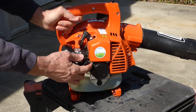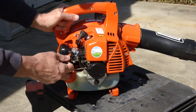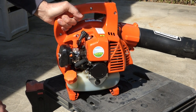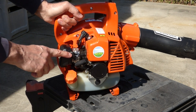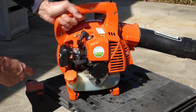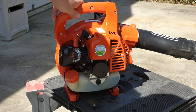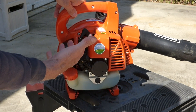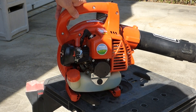She's firing! Go to half choke. Beautiful — choke off. Now those fuel vents, if they're bad, it takes a while for the pressure to build up in the tank where it's not pulling fuel anymore. So I'm going to run it for a little while to make sure that problem's taken care of — but it sounds great right now.